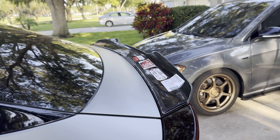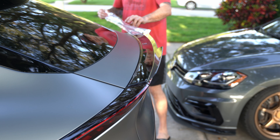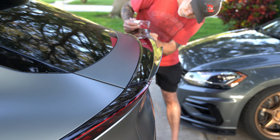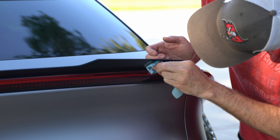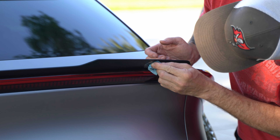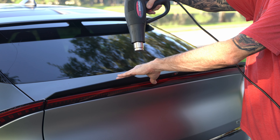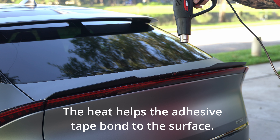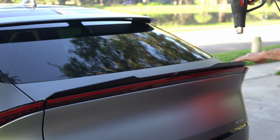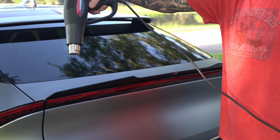Once you get it on, press it down firmly, then remove the protective sheet covering the gloss black top surface. I also removed the genuine Maxton Design sticker — when you peel it off there's a void on it, kind of like a warranty sticker. A little bit of Goof Off got it off just fine. The next thing I did was use a heat gun to warm up the spoiler cap, using my hand to make sure I'm not putting too much heat — you don't want to melt the plastic. Frankly, leaving it out in the hot sun for a while would probably have the same effect.